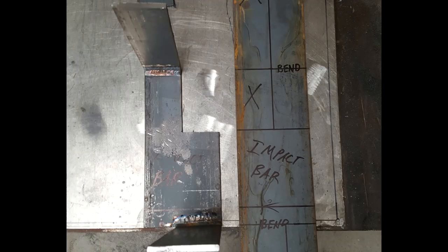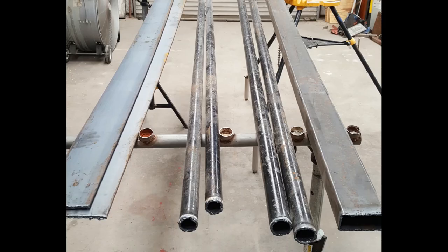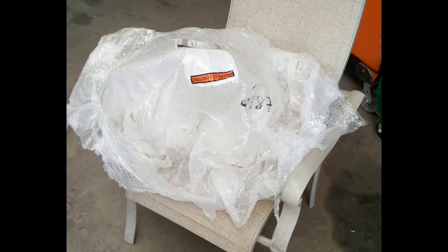As for the material, I used some 5-inch wide flat bar that was a quarter-inch thick for the mounting brackets. I bent those and then reinforced the bend areas with welds. On the main body of the bumper, I used 2-inch by 4-inch by 3-sixteenths wall rectangular tubing. For the railing around the top of the bumper, I used 1-inch and a quarter Schedule 40 pipe. I recommend that you clean it off before you start on a project like this — there's a lot of oil and protective layers on regular steel pipe. Just take some paint stripper to the pipe and wipe it down; it will really help you a lot.